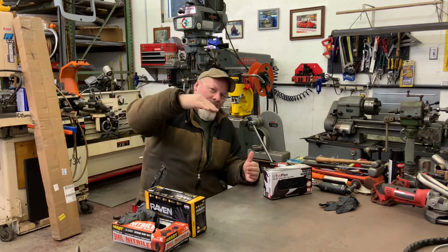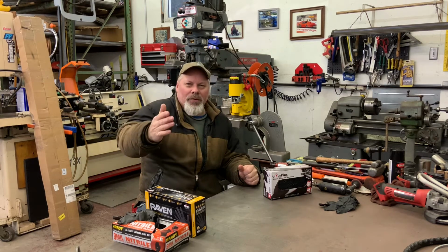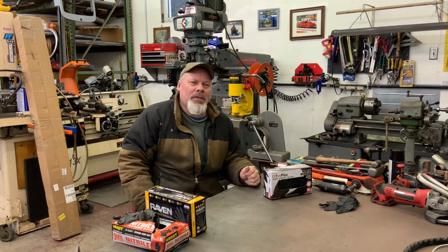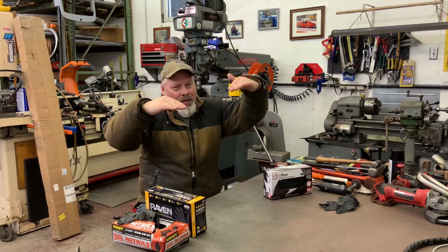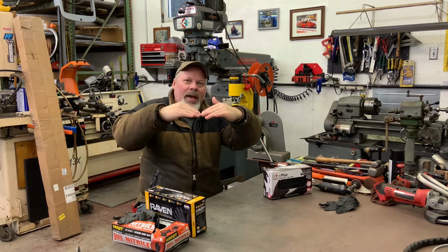You have the drive shaft coming down, in the Dart's case, from the motor. If you have a tube chassis car with a full link, it could very well be going uphill. In fact, it probably is if it sits right. But in this case, the drive shaft is coming downhill. The pinion's pointing downhill. Combined, that's your working angle.